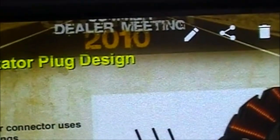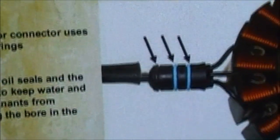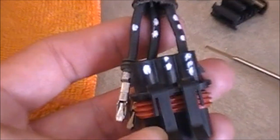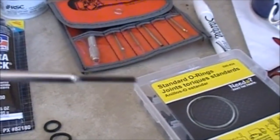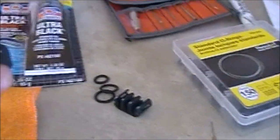To do that, you have to unpin this connector. What I did is label each pin with dots, because I want to make sure I get them back in the right way. They're pretty easy to take out — I left one in there to show you. You just go in on top at that little groove. I have a snap-on set, but for taking these little connectors off I just use a little flat pin. You can probably get a small flathead screwdriver in there — just stick it in the top, push down, and pull out the back, and it'll come right out.